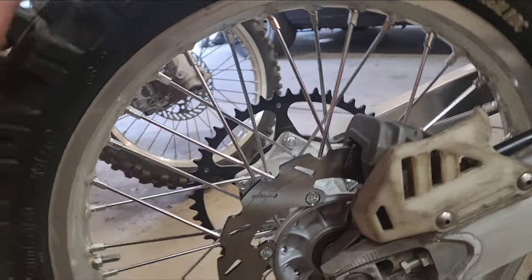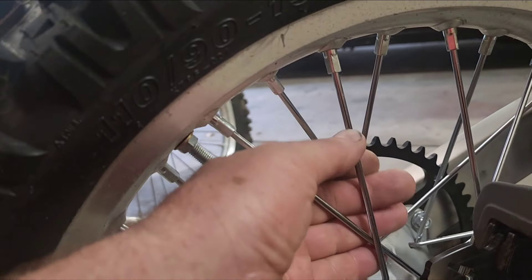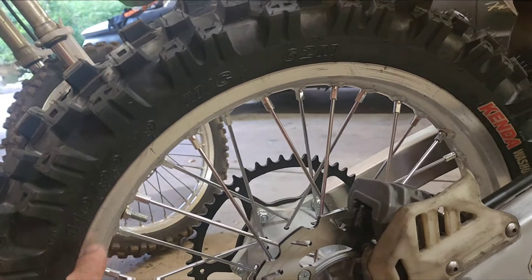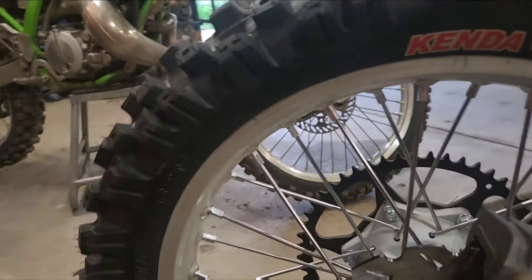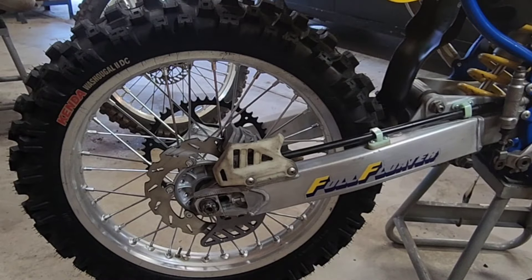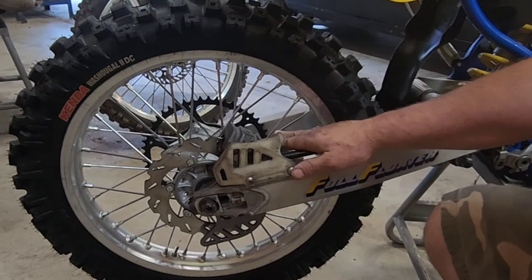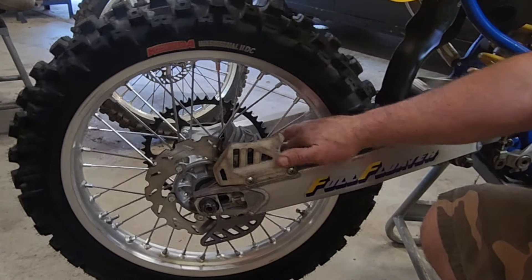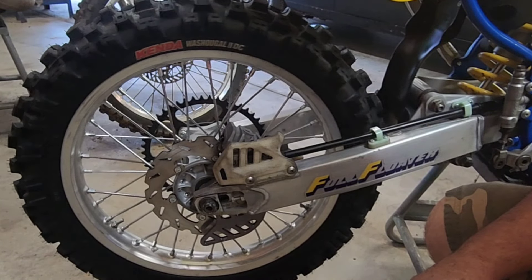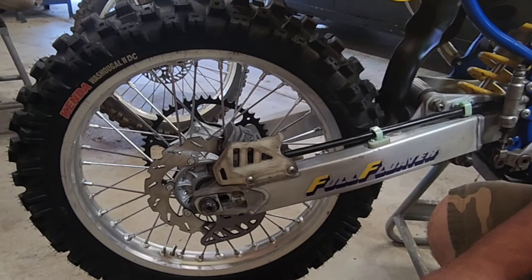The real problem I had with this was I had to get some new spokes. I had this 19-inch wheel — I wanted it to be a motocross bike — and the 18-inch wheel from my other RM sitting next to some muriatic acid while I was doing some nickel plating. Anything steel that was remotely close to that muriatic acid just rusted really super bad. Both of them.